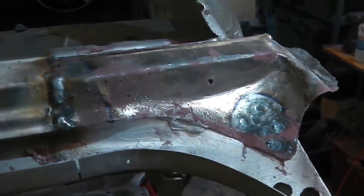There's some pinholes up here, we'll be careful how we tackle these. We might be able to get some metal threaded in at the back and just fix them that way. I think we can actually get some in at the back there to fix them, save blowing through. Won't get the copper bar in, but I'm thinking of getting a little bit of metal plate and just sliding it in and clamping it. Okay, so I'll just finish dressing this weld up now, and we'll see if there's any more welds needed to be done.